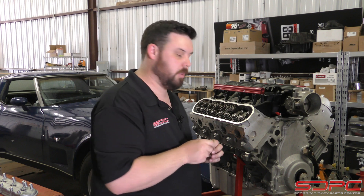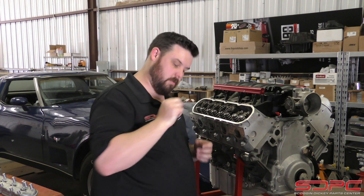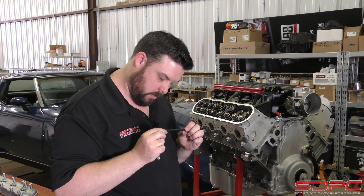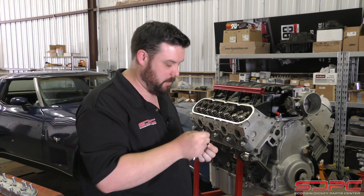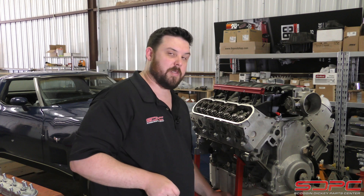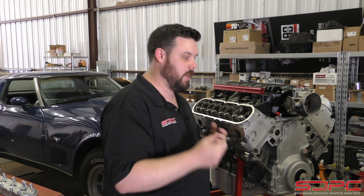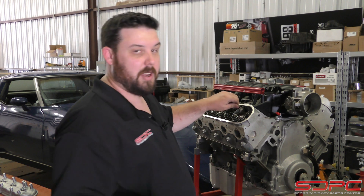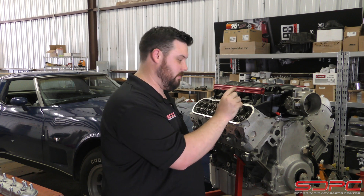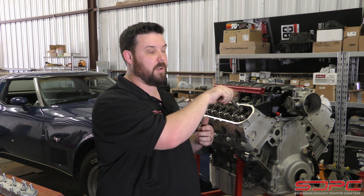7300 was a little loose and 7350 was too tight, so let's go right in the middle. Let's take this back out, do a half turn, and put it right about there. It's kind of hard to see a half turn because of the marks. Put it in carefully and do it one more time. This is a tedious process — there's a lot of patience required because you're constantly threading a rocker back in, pulling it back out, making measurements. Don't forget a notepad and a pen too, because sometimes you have to write this stuff down.